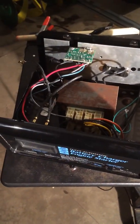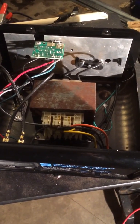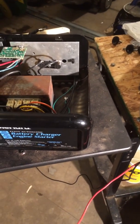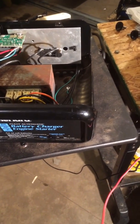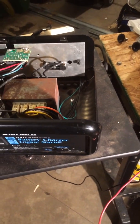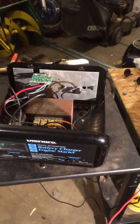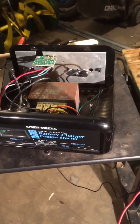Either way, it'll fix it — you'll get things moving. So when you only see those nine volts, just unplug the wire. Yeah, it's not gold standard. I wouldn't condone putting it on two amps, plugging it into my battery and letting it trickle charge overnight and come back — it's not going to know when to shut off. Not a good idea. But when you need to get your car started because your battery is basically dead, and you don't have time to let it sit and trickle charge all day on two amps, and you need a 10 amp or a 50 amp to start your vehicle, this will do its job.